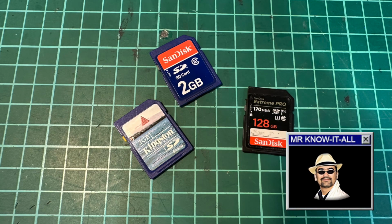Now, you may wonder the fuzz around those SD cards. Apparently nothing, as all three are good. Although there have been some reports about not all cards being compatible with the Pandora. However, I had also suspected it to be an issue with the file system. So for the third card, I specifically forced it to format as FAT16 instead of FAT32, which seemed to do the trick, at least for me.